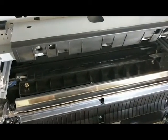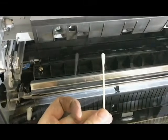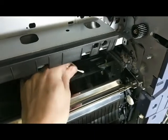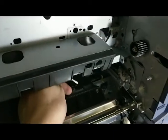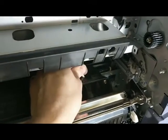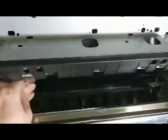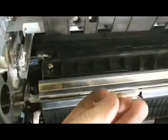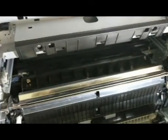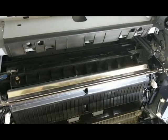After blowing all that out and cleaning it up, wipe it down with a nice soft towel, and then get a Q-tip. Slide this plate over, and you can feel that there's a piece of glass just slightly down there. Just rub the Q-tip on the end of it to make sure there's no dust and debris — do that for all three of them. You can see on the end of the Q-tip there's a little bit of dirt that came off. From here you can put everything back together, and that CA00 code will probably go away.